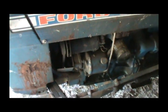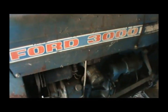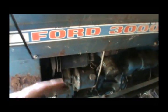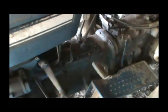What you run into is when you have to change the battery out or your battery dies, when you crank it up it's not charging. You'll have a light — can you see that? This is a battery light and this is the oil light. So when you crank it up, this stays on all the time, and that tells you that the battery is not charging.